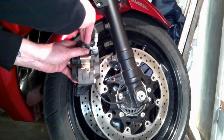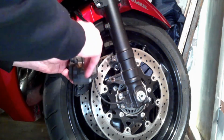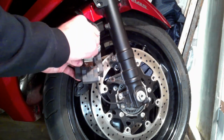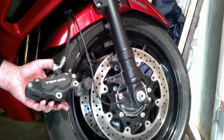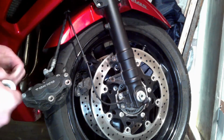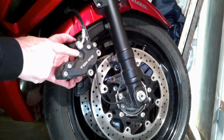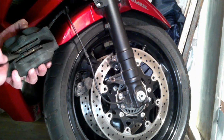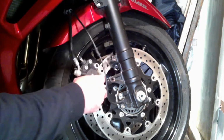So now with the Allen key, just tighten them, pinch them back up. Now you don't want to stand on these and overstrain them, there's no need for it. You know, you just get the feel of it. Now, you just pinch that centre bolt back up again, that one there, and just open the pads gently, just so I can put them back on over the disc.